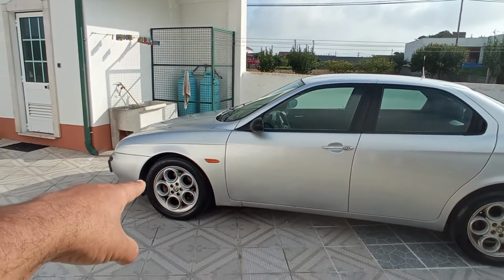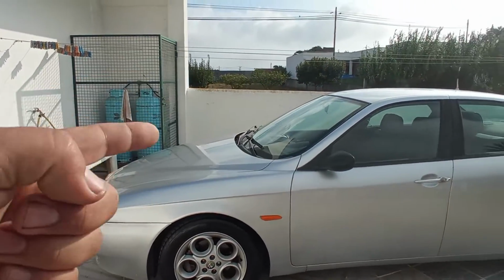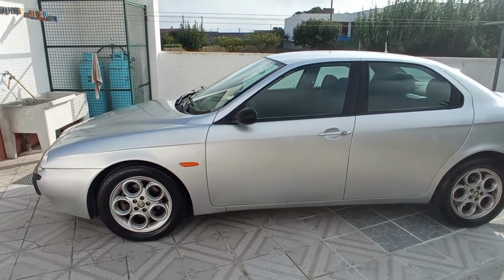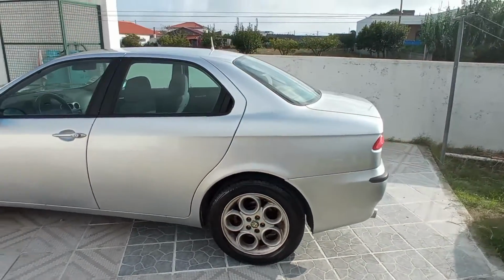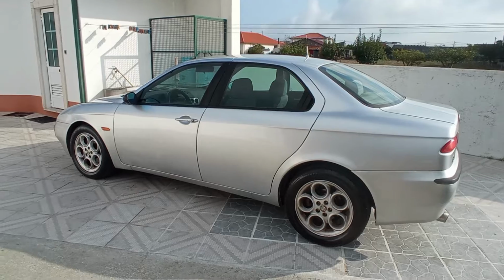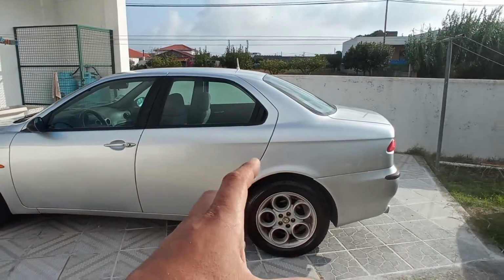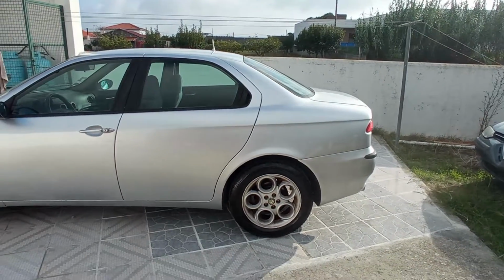I did a repair on the threadings of the wheel hub here. On the other side it was also done on camera, and this side off camera, okay. On the back side I saw everything is okay. I rotated the tires because the front ones were on the back and they were very old. They have to be on the front right now so that the rear of the car has more stability, because the new tires are now on the back of the car.